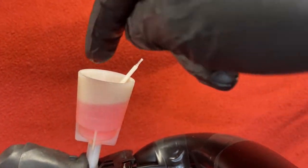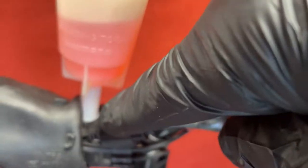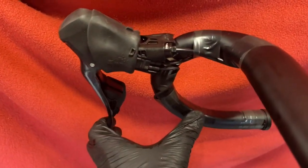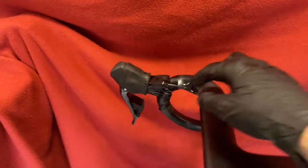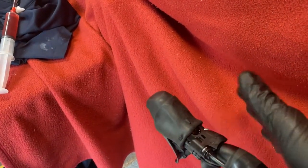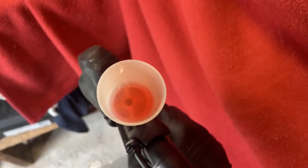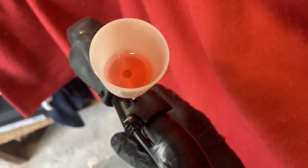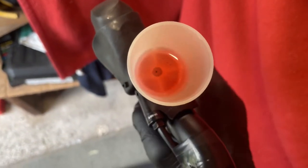So we're going to put the stopper in there and the stopper will stop all the oil falling out. Then we're going to put the bleed cap back on the STI lever and then test the brake. I've closed it up and we are getting about there. But if you're unhappy with it, just put the bleed pot back in and then just tap the brake closed and you'll see air bubbles coming in. There's an air bubble straight away and another one. So all I'm doing is just braking and that'll be replaced with fluid. This is also a technique I use when my brakes get spongy.